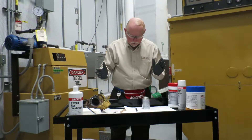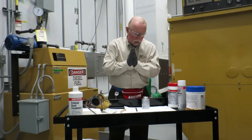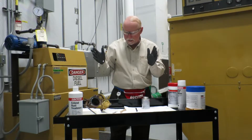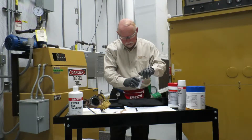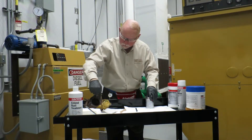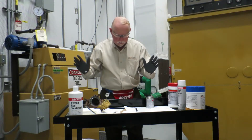So let's cover the things that you should do with it: bond trim, foam, insulation — like the headliners in cabs, stuff like that — door and trunk moldings, weather stripping, headliners. That's really what this is made for. It is good to dab a little bit on the gaskets and put them just about anywhere. But do not lather it on and then try to put two pieces of metal together — that's not the right way to do it.